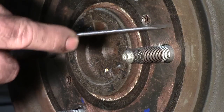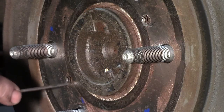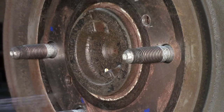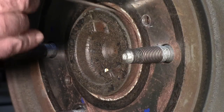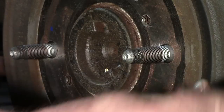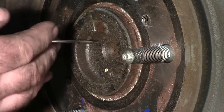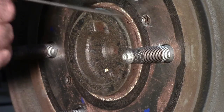One reason is the brake drum is actually sandwiched between the rim and the axle flange inside. Corrosion on this flange material can cause the drum to stick to the flange. The other reason is the stub of this axle is the centering device — it centers the brake drum to eliminate radial run out. There's also a bit of flange that the rim slides over, which centers the rim and tire radially with the axle.